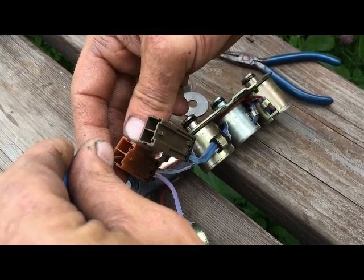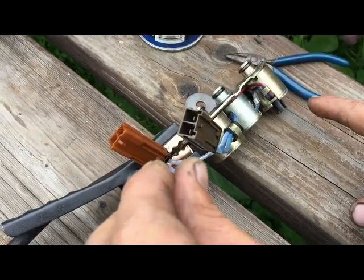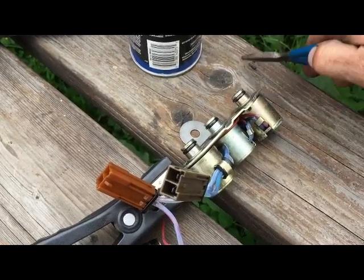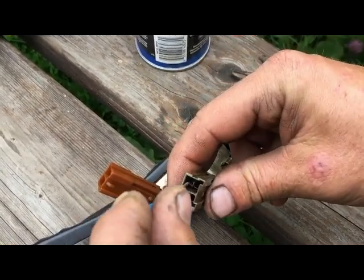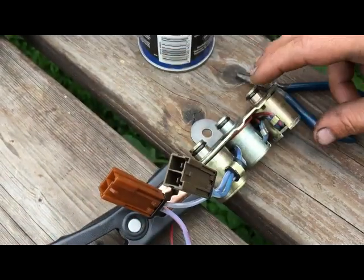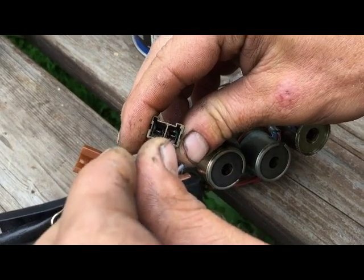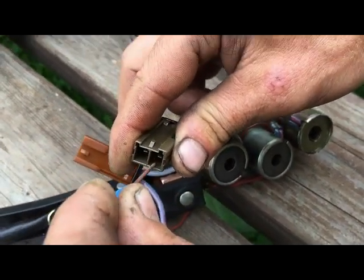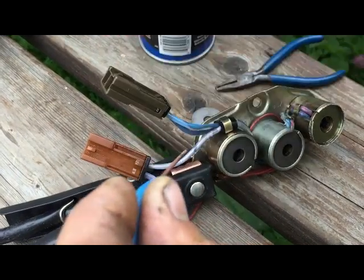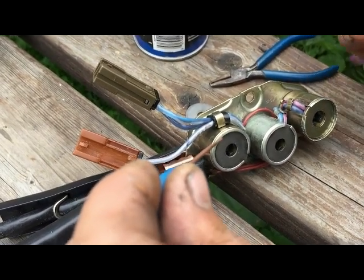They're not like the other solenoids. There are two solenoids in this transmission that will cycle. What happens is they get dirty — see how the piston popped back out? You actually have to give them a tap to get the pistons out. So what you need to do is just make sure these things are clean. As long as you get spark from your connection or check continuity with an ohmmeter, all you have to do is clean these things. If they're not cycling correctly you may have to pull them apart and clean them.